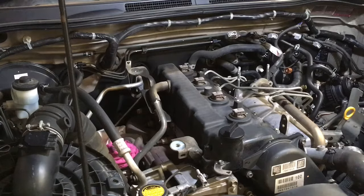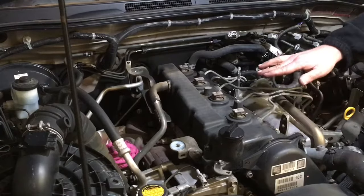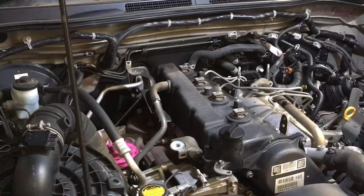And you can pull it apart and change the seals and put it back together, but if you don't clean it, it'll still leak. So it's not about new seals. The only time you need to replace those is if you damage them. If you rip this cover off over these and you're rough, you just have to go slow and gentle. We're going to get to that.